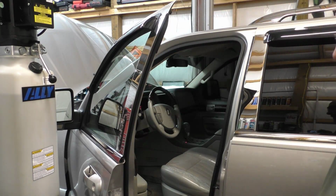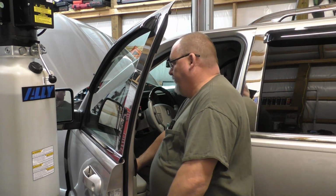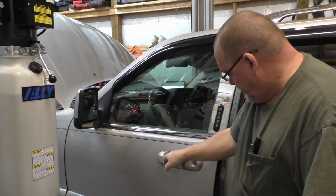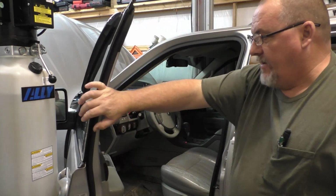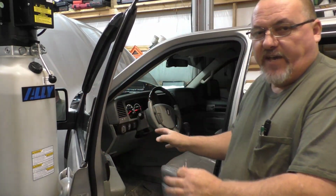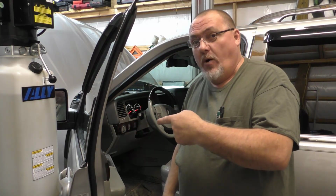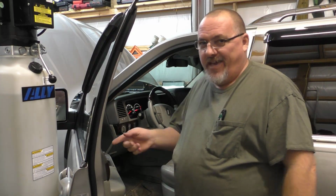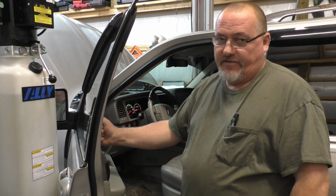So something, whether it be in the track or whatever, I don't get paid to open the door up and fix whatever the issue is on the inside. So, guys, thanks for watching. Just wanted to show you that real quick. Now you know. You replace this window regulator, make sure you activate the thing, because you will not have automatic windows until the activation process is complete.